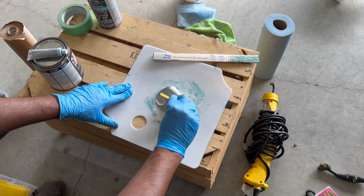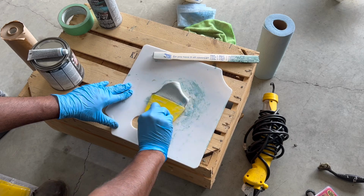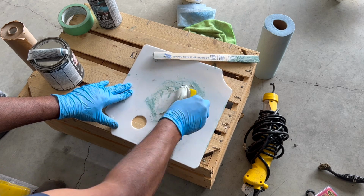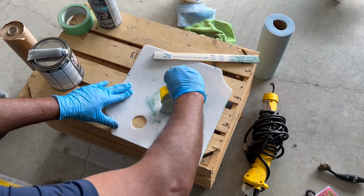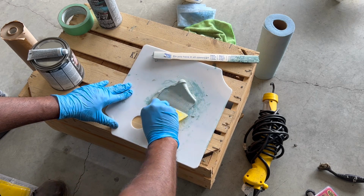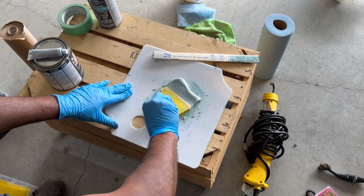Similar to before, mix it thoroughly by pressing the air out of the mixture. Try not to stir it. What you want to do is achieve a uniform color so that the hardener is completely mixed into the filler. Once mixed and you're satisfied with the color, which basically means you're not seeing any of the hardener as a separate product, then you're ready to apply it.